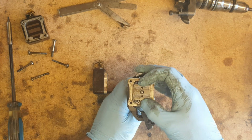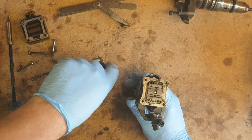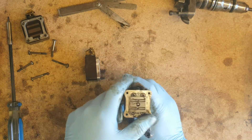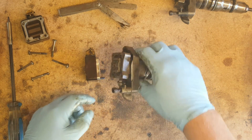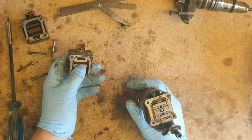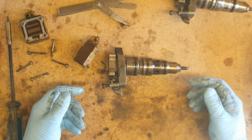The thick oil when it's cold under here — as it warms up it gets thinner and thinner, and as that happens it's easier for the solenoid to overcome the suction and open. That's why it seems like all of a sudden the truck starts running right. It's not really hurting anything by running a truck like that, but it's pretty inconvenient not having full power. This doesn't have to be done on the bench — these solenoids can be taken off in the truck, you can check everything with everything installed, with no need for a big mess and pulling away a lot of components.